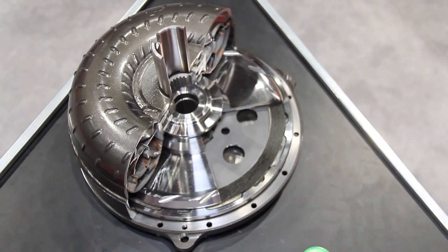This seems like it's a piece of equipment that if you're a drag racer, it's kind of a necessity. This thing is awesome. For a 2010 and up 6L80E transmission in the Camaros, it's the only way to go. 2450 high stall converter, triple disc lock-up, bolt together, billet converter, and the thing actually works.